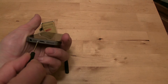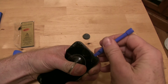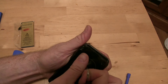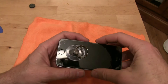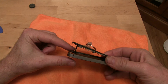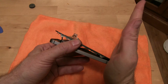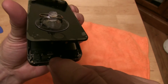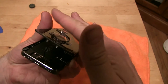You just unscrew this screw and this screw. I'm using the thumb loop in the suction cup to pull this thing up and get it loose to reveal the inside. Depending on what kind of phone you have it's going to be different, so I'd recommend watching the specific tutorial for your specific phone. An iPhone 5s has the fingerprint sensor so you don't want to bend the screen more than this because you have to take this cable out. On a regular iPhone 5 you can just open it — never more than 90 degrees or you'll damage the screen — just open it up like a hood and then take the battery out and replace it. Pop this little clip off to release the cable that handles the home button and then open it up.